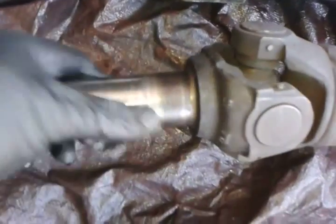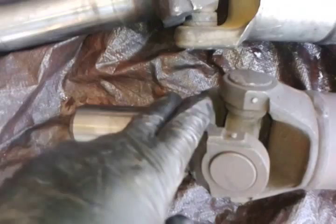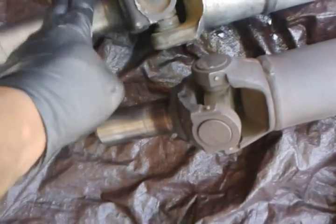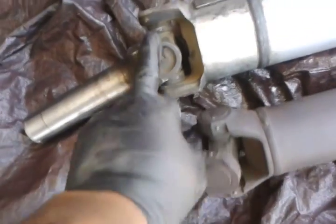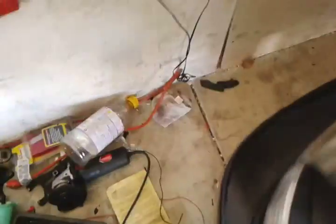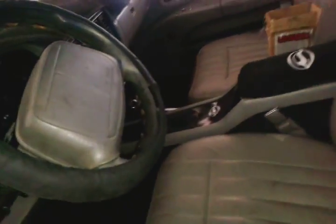You're going to take your yoke off the LT transmission and put it on the Crown Vic. You're going to take your yoke off your driveshaft, put it on the Crown Vic aluminum driveshaft. And then you're going to need the U-joints. The part number is 355 — you need two.